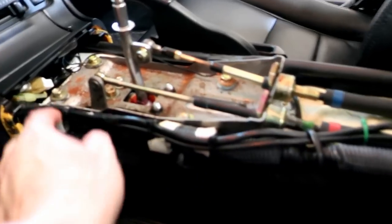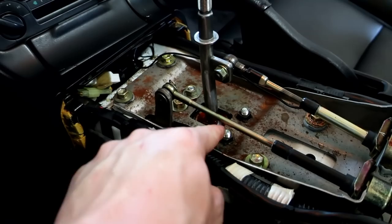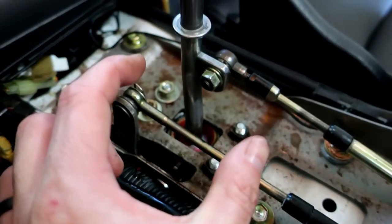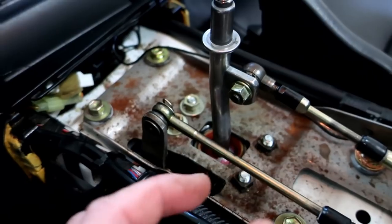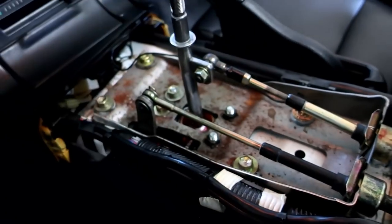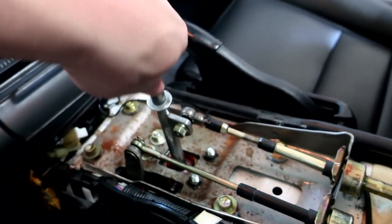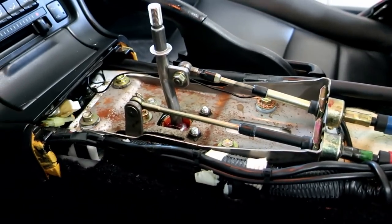The shifter is back in now. It does come with a couple of extra bolts — these three longer bolts are intended for the three spots where you put the base plate on, which goes underneath the shifter, not above. When you put that under there, it means some of those stock bolts aren't quite long enough, so Superclass includes the proper length bolts. You put all the other factory bolts back in. Everything is working good — make sure you grease it up. It comes with grease, though I used my own. I'm excited to take it out and try driving the car.